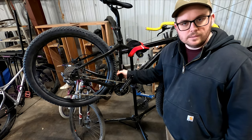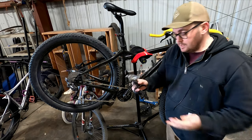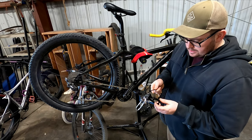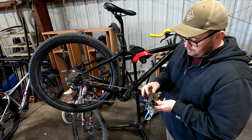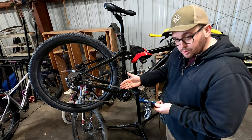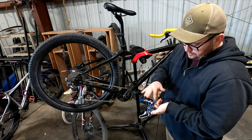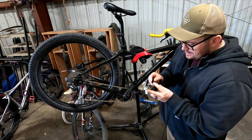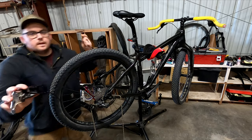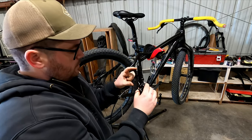That's another crucial piece of the puzzle here — there's no way to mount the front derailleur right here obviously, so you need a clamp-on collar. This also says it needs to have 55 millimeters of offset, and they used the company Problem Solvers to create that. I ordered it and it's on its way — should be here any day now. I realized I have one from an Ice Cream Truck that I hadn't measured. It's probably about the same, but my main concern is whether the tube diameter is big enough. I think I need a 34.9, and I don't think that's what the Ice Cream Truck outer tube was — and it is too small. So I'm going to have to put this on hold until my clamp-on adapter comes, which unfortunately isn't until Monday. Then we'll be able to put that on and be good to go.